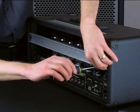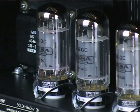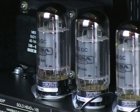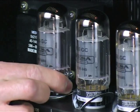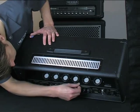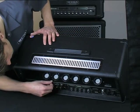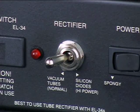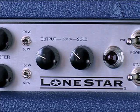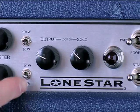Put the amplifier in a position where you can remove the tube protective bar. Power and rectifier tube socket positions have thin, flexible metal clips designed to grasp the plastic base of the tubes — spread these out by bending slightly downward. To remove the tube, pull upward and slightly rock back and forth. While the tubes are removed, inspect the tube sockets and make sure there are no burn marks. If any burn marks are detected, they must be removed by a tech before the amp will work. If the amp has a rectifier select switch, put it in the silicon diode position. Amps featuring multi-watt selector switches such as Stiletto Deuce, Stiletto Trident, Lone Star, or Lone Star Special must be set to full power to ensure all tube sockets are live.